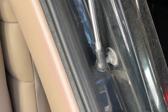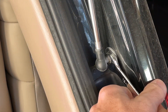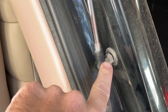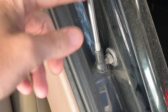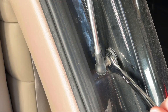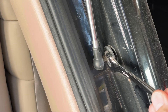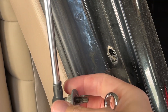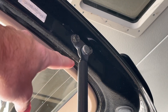Now I'm on the right side, the passenger side, and I want to remove this here. I'll use a 12 millimeter wrench. I don't know how much tension this is under, so it may try and push down — I don't know if one or both sides are weak. There's quite a bit of tension here, so I'm going to lift up on the liftgate and then finish loosening this. Okay, I got that out, so I'll let the tension off. Now I'll switch to the upper bolts and loosen both of those.